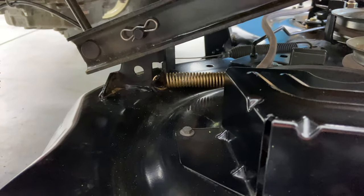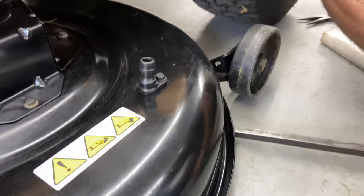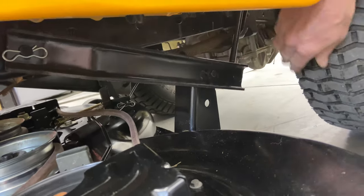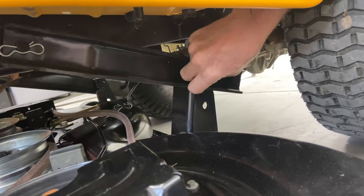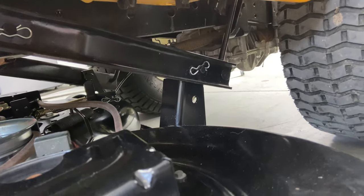I'm just moving the mower deck back and forth until I get it lined up, then use the pry bar and just pick it up a little bit — slides it right in. Using my pliers here — bow-tie clips are nice but in this circumstance they're a little hard to get on and off on the back side, but that's the way it should be. I'm going to go ahead and do the other side — lift it up with the pry bar and just move it a little bit — slide it right on.